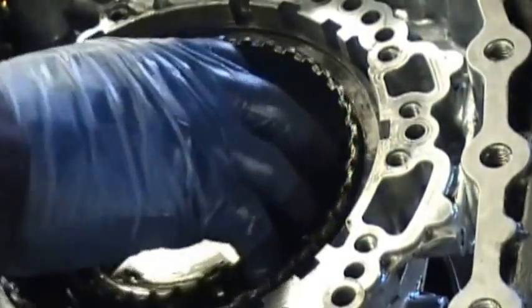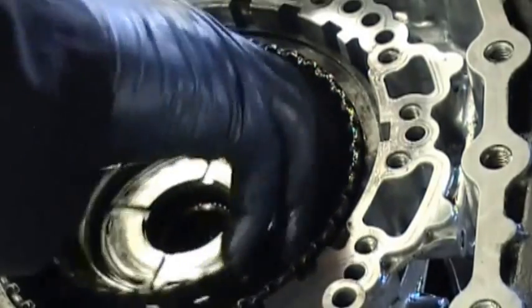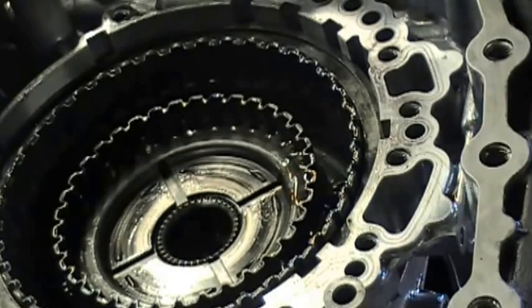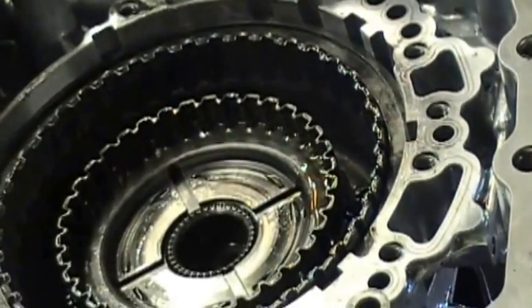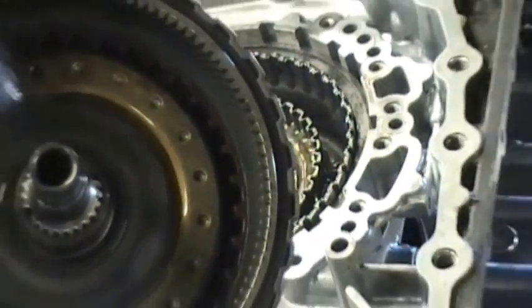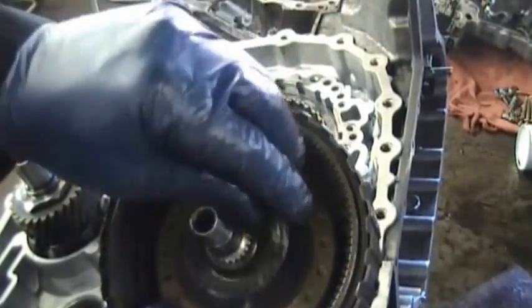If you don't, then some of the clutches, the drum have not completely gone to the bottom, and some of the clutches have it contained. You don't want that, because when you start to put things together, nothing will fit perfectly because it will be too tight. That normally shows in being unable to turn the input shaft after you have tightened the bolts down. Furthermore, if you tighten them all down, it's possible to break something or bend something.